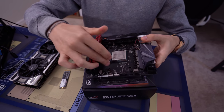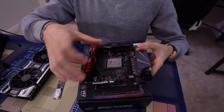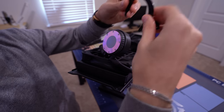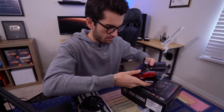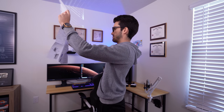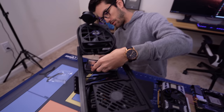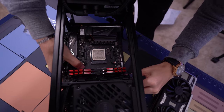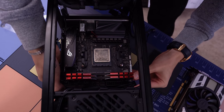The water block comes with mounting gear in the case, so we'll use that to get the block secured to the motherboard. Because we're using an AMD system, we want to remove the Intel bracket and the AM4 one should just slide in. I've got a little baggie of goodies and I'm totally not referencing the manual. I want to make sure my orientation is correct here. The rear I/O shield goes in like so, and we're going to align it with the I/O shield and the standoffs. Let's go grab the screws.